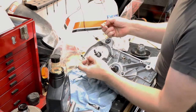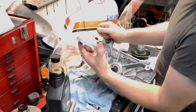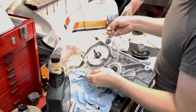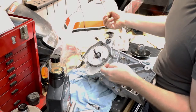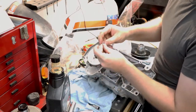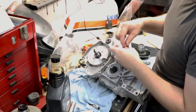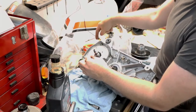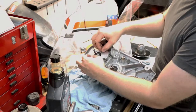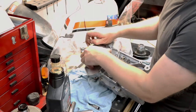So like I said, this is a base plate that I bought when I bought two Start 5 motors off a guy, Tyler, on Moped Army. He had these already made up, so I bought one or two of them. They are not for an MVT, but with the modification of putting this groove in so that it locates the outer edge of the stator, and also modifying some M6 screws so they had a much shorter countersink so that they would sit flush. I'll also have to drill and tap a couple of threaded holes in there, because this one uses a slightly different pattern. But you can see for test fitting, for this part anyway, that this definitely goes on.